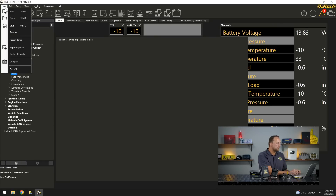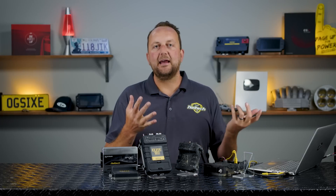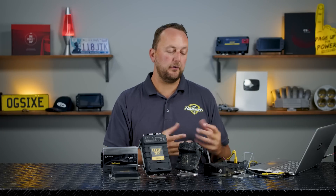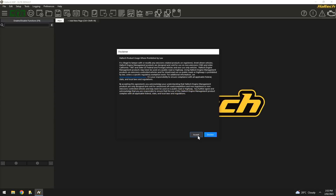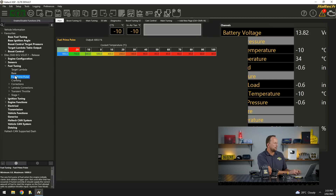In order to fix this, we go to File, then Restore Defaults. This is going to wipe the setup in the ECU — the trigger system, how many cylinders the engine has, all the trigger setup, ignition setup, fuel setup — it's going to erase all the fuel maps and ignition maps and load defaults with no password. I'll go 'Restore All' and accept the use disclaimer. It writes the map into the unit. This is quite an old ECU — probably seven or eight years old — but after resetting it, we've got a default map in the unit. She's back to brand new.